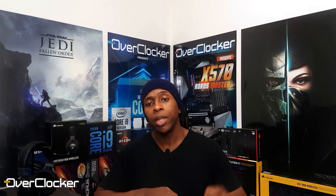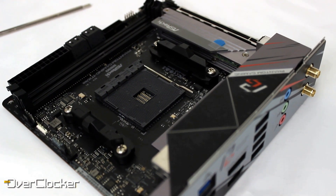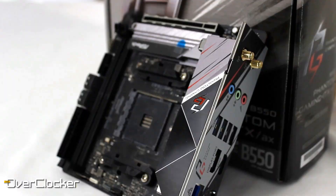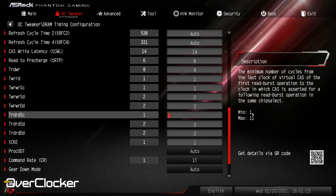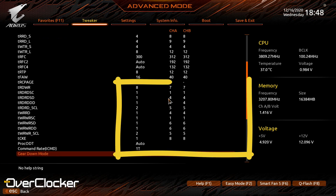This is part of the reason I like this board — it's easy to overclock and very predictable. Usually for AMD motherboards I've found that recovering from a failed OC can get quite difficult, and sometimes the board will just refuse to recover and you have to remove the battery, but that's not the case with this motherboard. I also don't have a POST code LED, but I don't need that because the board is so reliable — once you dial in your settings and save them, it will POST time and time again. The one thing that is true is that I cannot tighten some timings as tightly as I could on the AORUS motherboard — on the ASRock some settings can only be set to two ticks whereas on the AORUS board you can set them to one, and that board is particularly efficient at memory overclocking.